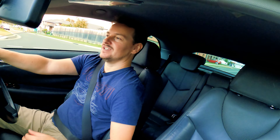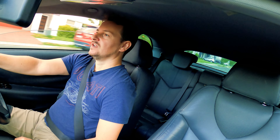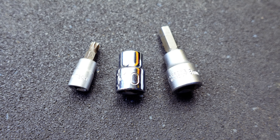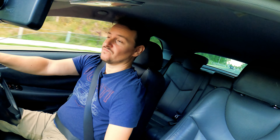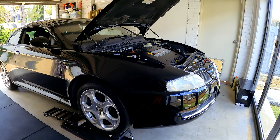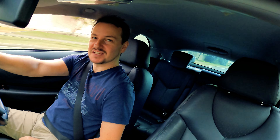That's how easy it is to change the oil in an Alfa Romeo GT — not very hard at all. Just keep an eye on the level of your oil to make sure that things don't get too low, otherwise goodbye engine. All you're really going to need are those three little sockets: a T30, a 10mm to undo the under tray, and then an 8mm hex socket to undo your drain plug. After that things are really easy — just top it up. I hope you liked what you saw, and if you did please give this video a like. If you'd like to see more videos from me working in my garage on car projects, please consider subscribing. A really easy job today, and I hope this helps you get the oil changed in your Alfa. Go ahead and try this on your car — see you next time!